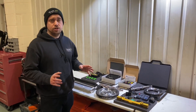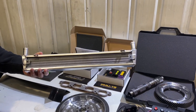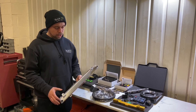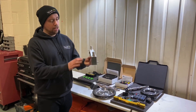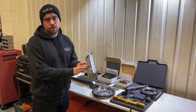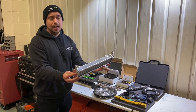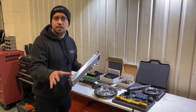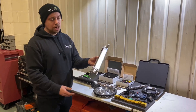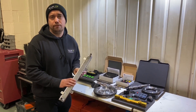Next is the charge cooler. At the start of last season we developed this with RRR Engineering. When we started running more power, we noticed intake temps rising, so we came up with a neat, lightweight aluminium secondary charge radiator cooler. It sits within your crash box in a high-flow area and piggybacks off the existing charge cooler. It's a pretty easy install, relatively cheap, and on average reduced our intake temps by around 15 degrees.